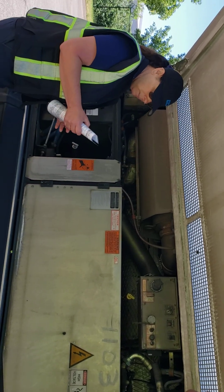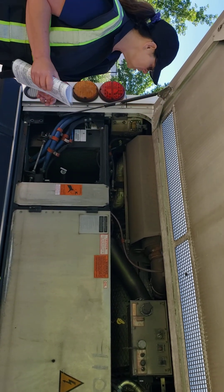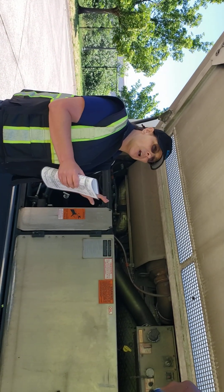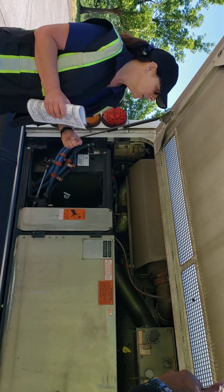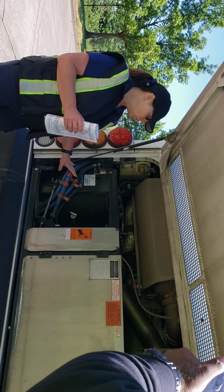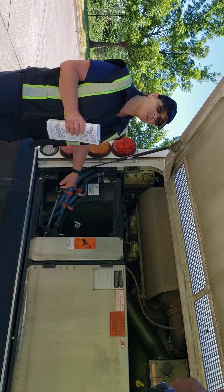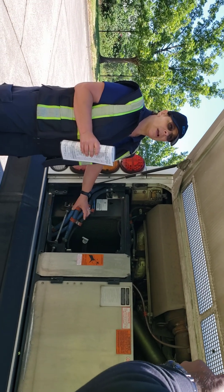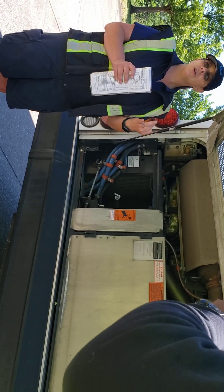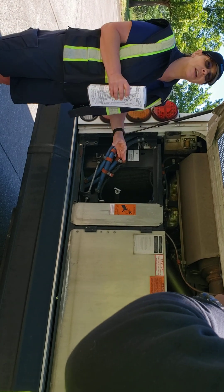This bus does not have an alternator. We're going to check to make sure there's no leaks in the engine compartment, and we're going to check our hoses for condition — making sure the hoses are not worn, there's no holes. Generally, when we're talking about any kind of rubber part, we're going to talk about the ABCs: no abrasions, no bulges, no cuts. That's how you know it's in good condition.